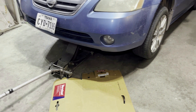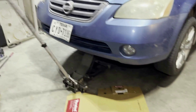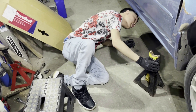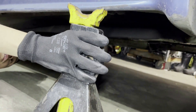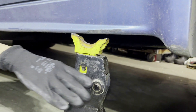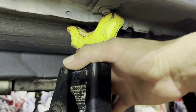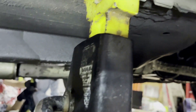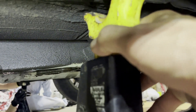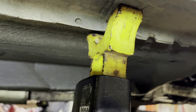You want to jack it up high enough where you'll have enough room — you don't want to be all crunched up in there. He's a small guy so this probably works for him. Now I'll have him put the jack stands. We're using these longer jack stands and he's trying to figure out how they fit on that pinch weld. He figured it out. You can set it up there, put the jack back and it'll eventually catch, or leave it loose and when you bring the car down it'll sit on the jack stand — that'll be fine too.